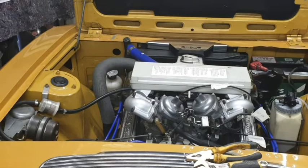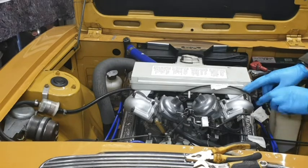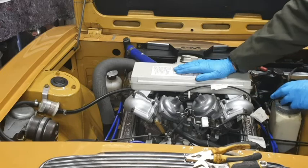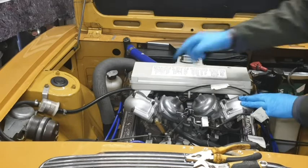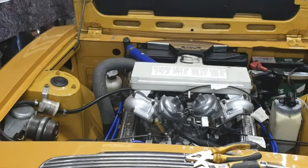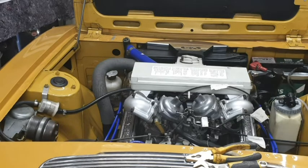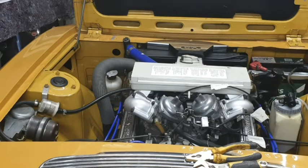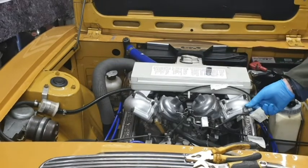She's done. And then, so that we can get nice and easy access, what I'm going to do now is to detach the air filter box and these intake angles from the carburettor, and then that's going to give me good access to the point where the choke cable that we haven't taken out yet is located. So I'm guessing they're going to be 9/16. Let's have a little look. They're not 9/16, so they're halves. They are.